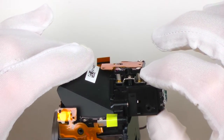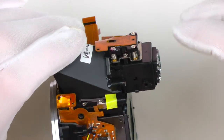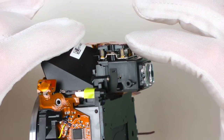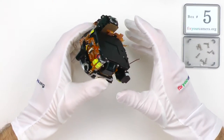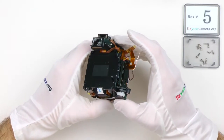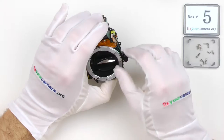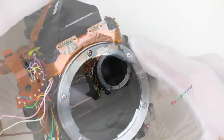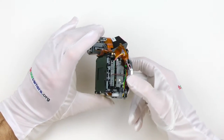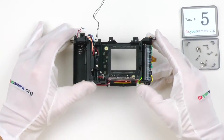The light meter is adjusted at the factory. If you squeeze it with your hands, you might cause some problems and it may require adjustments. On the bottom, there is a focusing sensor. If you touch or squeeze this one, the camera will very likely have focusing problems and again require adjustments — pretty much impossible to do at home without tools. So this is the mirror box, and this is the mainframe that holds all of this stuff together.